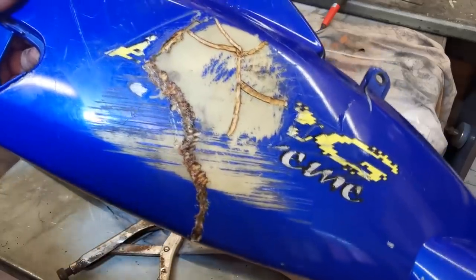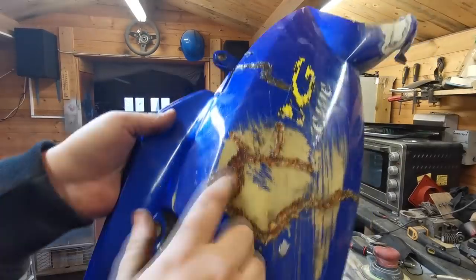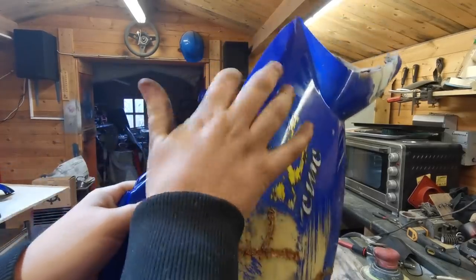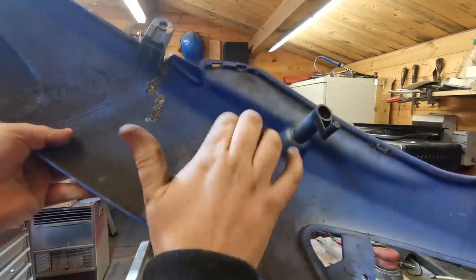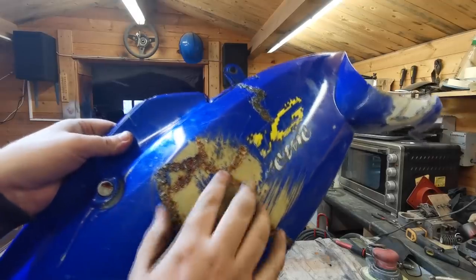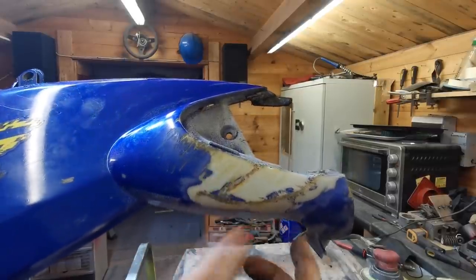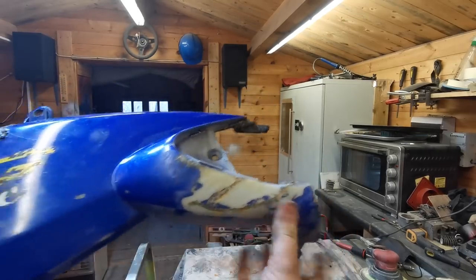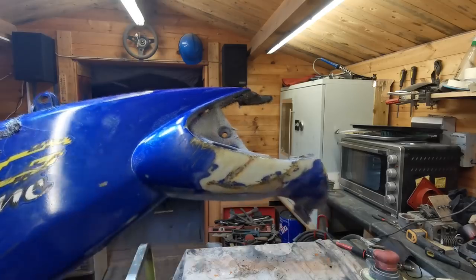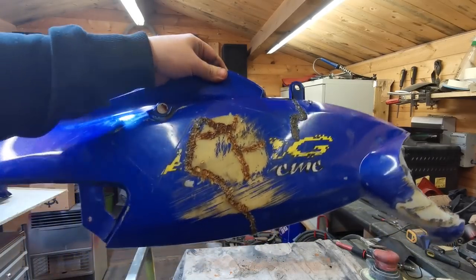Welcome back - as you can see I've fully done that. The little piece I put in is solid in there, and I did actually fill them two little holes up with plastic as well, so that's really solid again. There's some more up there I've done and on the back that is solid. So what we're going to do now is get some 120 grit paper on the DA sander and go over this just to get all the excess off. You can see down here where I've rubbed it down - all the plastic is in that crease now, and that's rock hard, no flex in that at all.